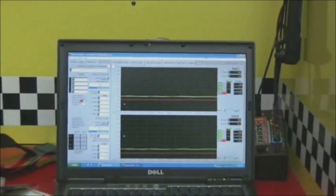A question: someone says they don't have a lab scope — what is another way they could view this current? That brings us to the next step: being able to do solenoid fast checks. We're going to show that with this vehicle, demonstrating how to check for voltage, check for ohms, and check for amps. This can be employed with a whole variety of different vehicles.